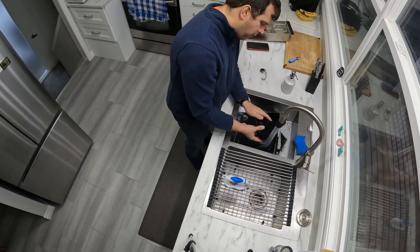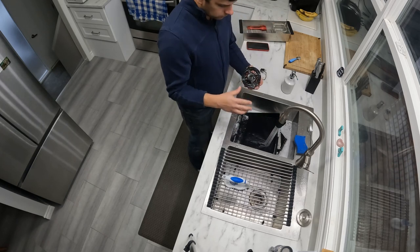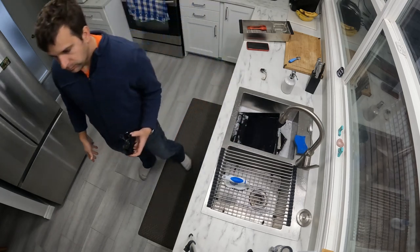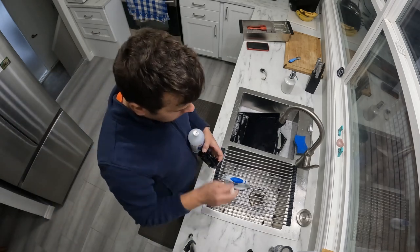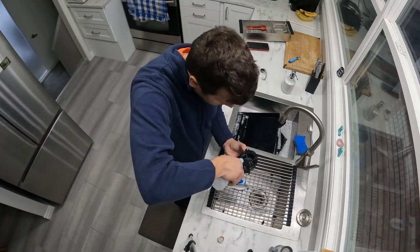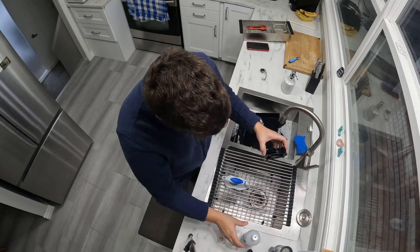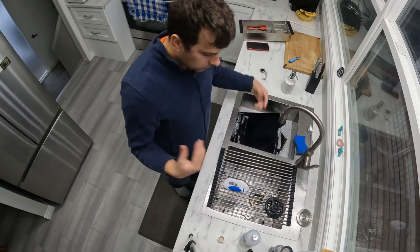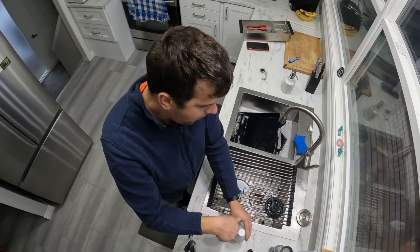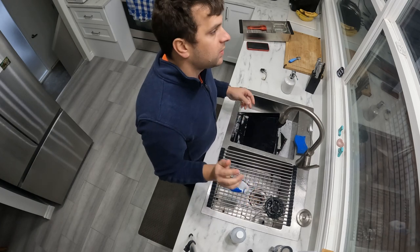So now that I scrubbed the fins off and the top, I'm just running the fins over the tap there just to spin off all the junk and debris. I'm going off there to grab my isopropyl alcohol to flush out the center hub, dry off the fins on the fan blade here. So right now I'm putting the isopropyl alcohol into the control board where the wires go into the center hub. So I'm just flushing the alcohol into the hub there just to flush out the water. And put it off to the side, let air dry, off gas.